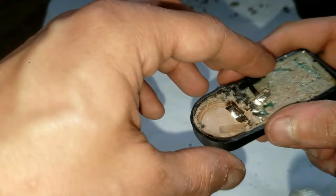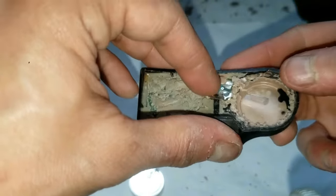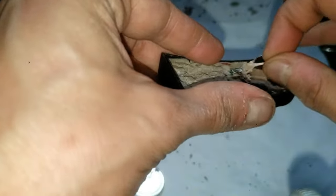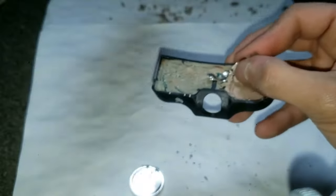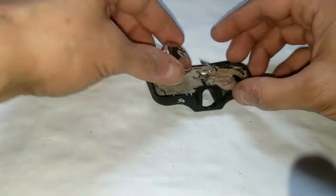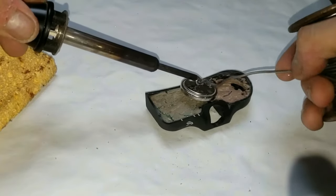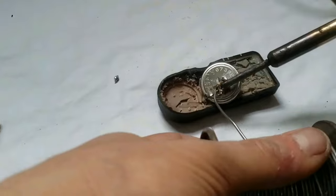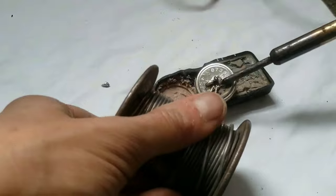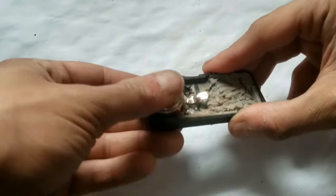Now I'll put a new battery in and solder it in place. Remember the position of the battery and specifically where each tab connects to each side of the battery. I'm going to remove some more silicone on the bottom first. Soldering this on — folding it back. I'm not the best at soldering, but for the purpose of this video it should be good enough. I noticed the solder doesn't stick well unless it's on the tab. Once the back side is done, push it in place and now do the front side.